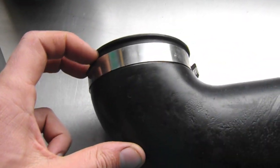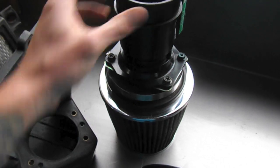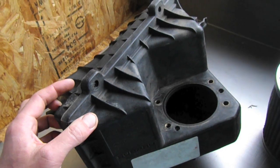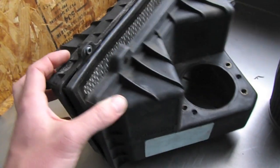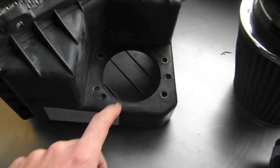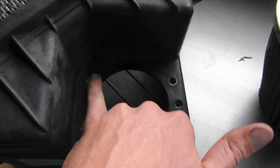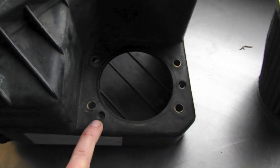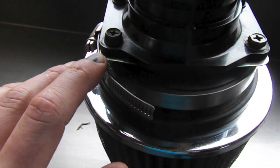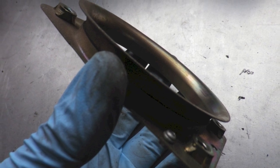This end connects to the mass airflow sensor. The mass airflow is actually mounted to a cone filter. The stock Subaru airbox would be great to use, but cone filters work pretty well. To use the cone filter adapter, you have to take out the screw-in adapter — drill out the two rivets — and pull the metal gold piece out.